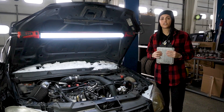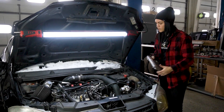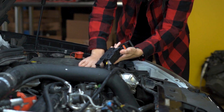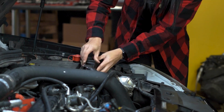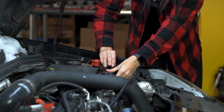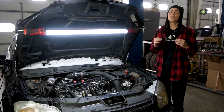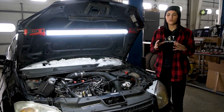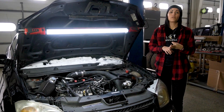Once you receive it back, please make sure your negative battery terminal is still disconnected. You are then okay to go ahead and replace your core. This is a better option than the refundable core charge because if you can afford any downtime, you're going to avoid getting security relearns, emission issues, or other things like remote starts not working. Please do not send us a core from a junkyard, as you can run into issues like it being locked, not working, or even not compatible with the vehicle.